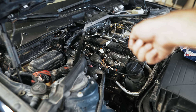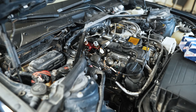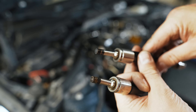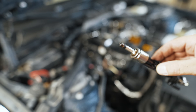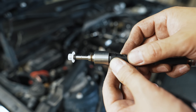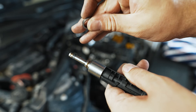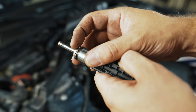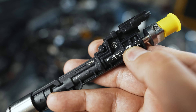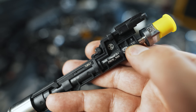When I did this on the N54, I could use a pick tool and pull the injector out. But I think they designed it a little better now, so you really would need a tool like that. Pulling out cylinder three — I was suspicious of this one. When you look at the two, it is a little bit darker than the rest, for what it's worth. The other ones have more of a brownish silver tip. The new injector doesn't come with a compression sleeve over this. I think they expect you to use the tool to install it. I'm going to put the decoupler on, bring the piece over with the washer side toward the injector and snap it on. Note down the calibration number — the other injector says 060, that's kind of like a generation code. This one is 310, and each injector will have a different calibration number.